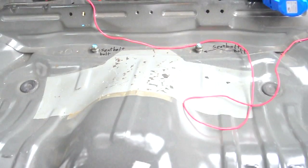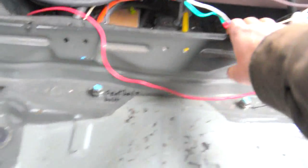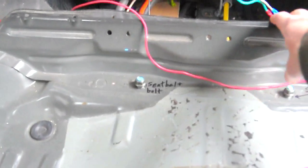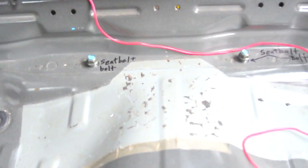The entire back seat has been taken out. You can see in the back here are the two seat belt bolts — here and here. This is a fairly solid point. Directly underneath it is kind of the bulkhead, and that's going to be a support point for doing a battery box in here. And then in the front as well, this front edge here is also a sort of an extra sturdy point.